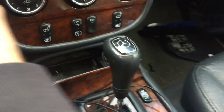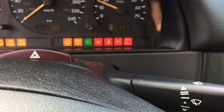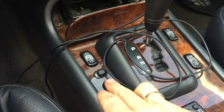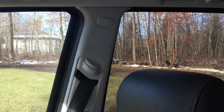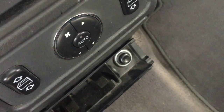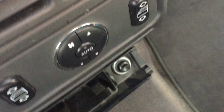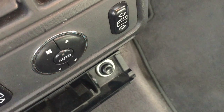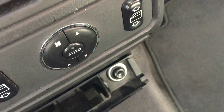When you actually turn the car on, if you click on the window switch lightly, you can almost feel the motor click, and I can almost get it to move just a little bit. One thing to mention is that this rear automatic climate control unit is always flickering regardless if the car is on or off, if the key is in it or out of it. It's always flickering. And I can get the flickering to become slower when I press the driver's side power window button.